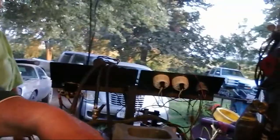I will just roll over. You guys notice how tall this is? Right there is a parting line. This is the Victor Jr. tall. It's got about 1.25 inches extra aluminum on it. That intake was designed for classes that couldn't run spacers. So that intake was made with built-in spacer, which means if I stick that in the Monte Carlo or Camaro, the carburetor will not fit under the hood.